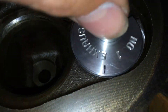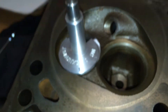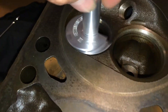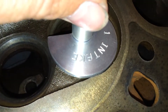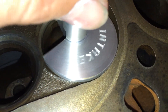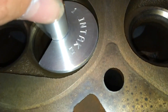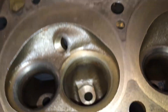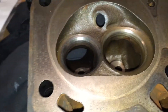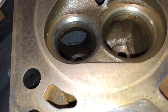Same again on this one — the tool won't go through. They're actually quite nicely made, these tools. How to use them isn't as clear and it's taken me a while to work it out, but they work quite nicely. Same story with the inlets — I just want to check with the widest part of that cam that we're not too far away. If we are too far away, they're being deshrouded too much.